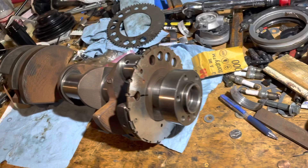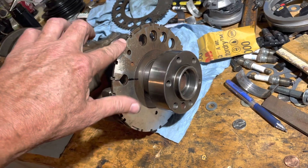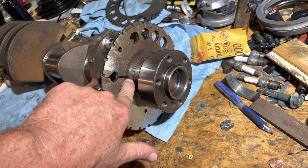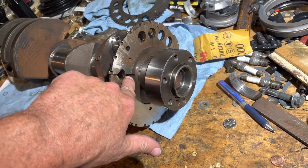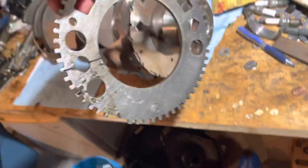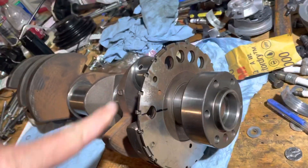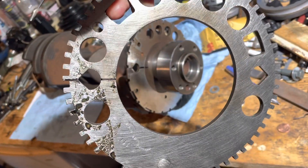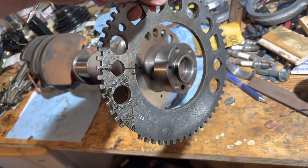Well, that tool is $200. I think there's an easier and cheaper way to do it, and I'm going to try it. So what I've done is taken a Sharpie and marked it right here through this arrow. That Sharpie mark should line up when we're done. I've taken the 58-tooth wheel and put the mark on a similar location. That hole by my pinky is the same alignment hole, and I put the line on the same pointed shape symbol on this thing.